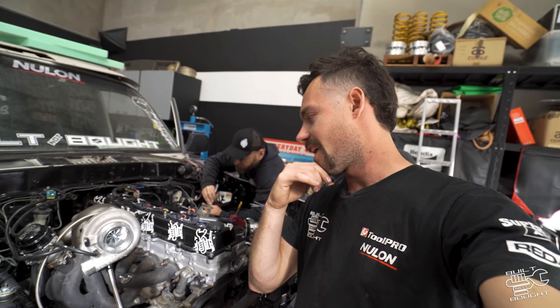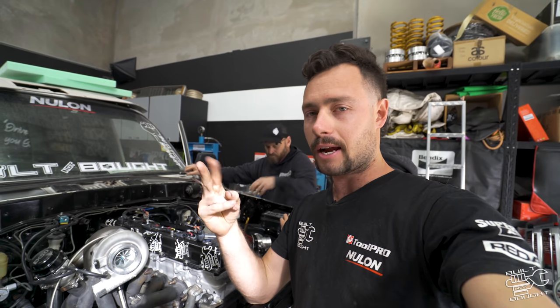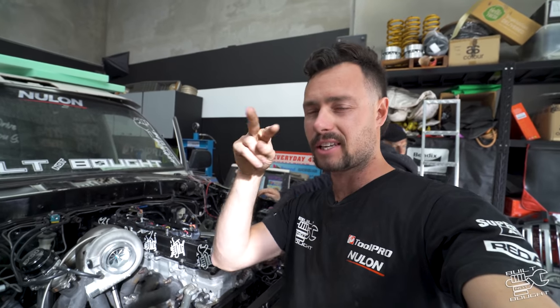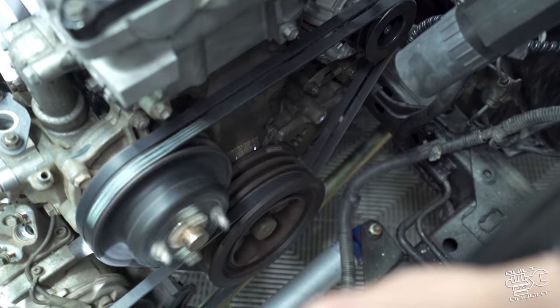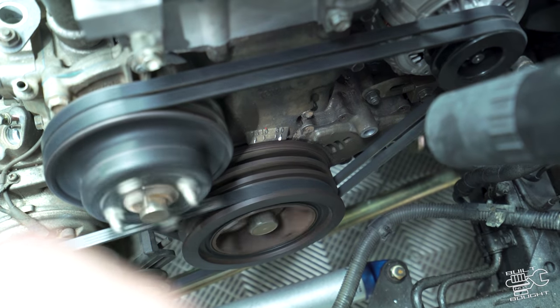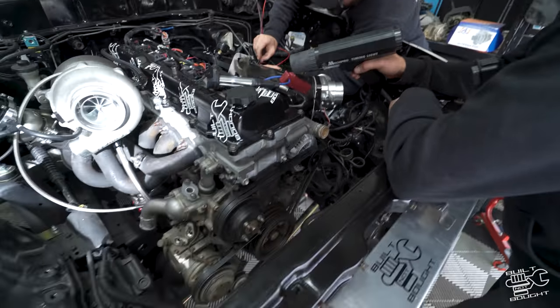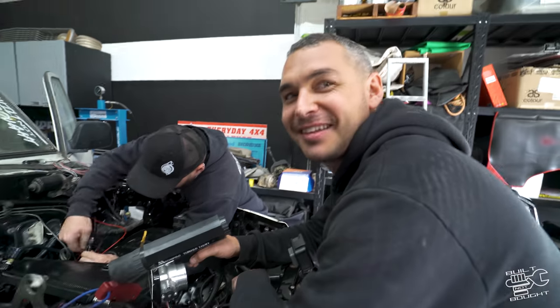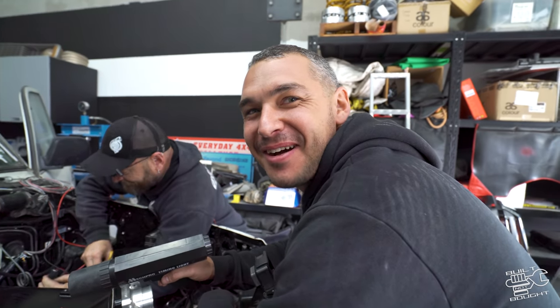All right, so we went to fire it and it didn't. Now the two big things that set your timing obviously are your crank and cam sensors — the polarity of them can be the wrong way around. I wasn't sure on the cam sensor because it didn't have a numbered pin. We've just got a timing light on there and it was about 30 degrees retarded. I heard it trying to fire with a valve open and it banged through the exhaust. So the timing's way out. Gonna play with changing this pin around and see if that fixes the issue. Pretty sound with petrol motors setting the timing and getting all your spark right. I'm freaking out — I'm like, I'm gonna have to pull the motor apart, start again. My timing's on. I've only spent like 20 grand on building this engine.